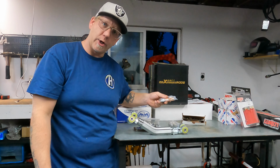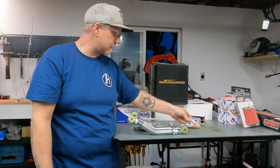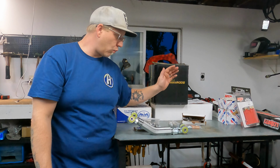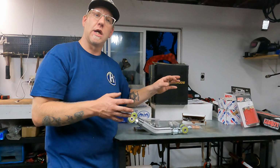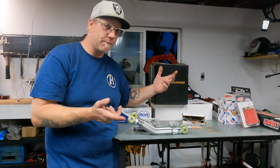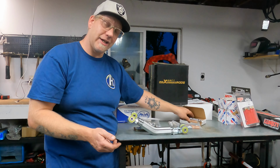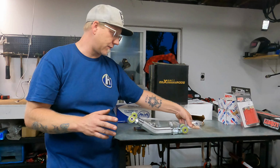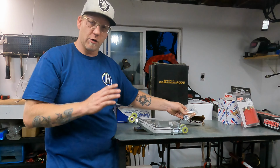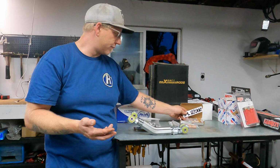And then that's what I bought these for, not for tie rods, but for the toe arms, the rearward control arms in the back. I bought these because those can be relatively straight with just a slight bend in them, and I thought I might be able to bend them with my bender if I really needed to, or I might just do straight bar. I'm hoping to just do straight bar, and with the spherical joints it'll make up for the bend that needs to be there and all the motion.